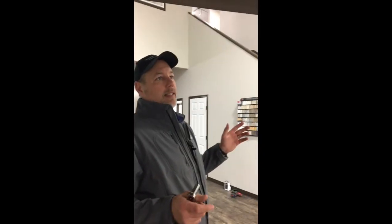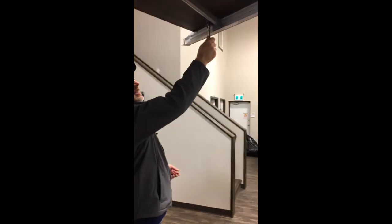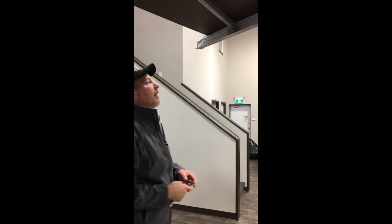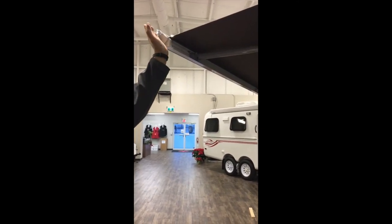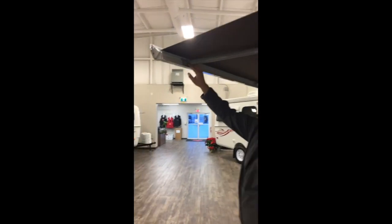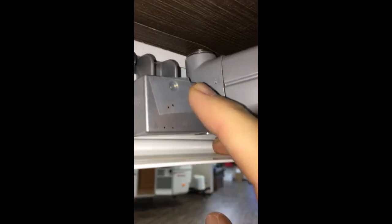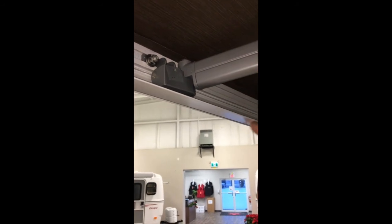We were at 10-3/8ths, so if I wanted to pull a little closer, I'll go closer to 10-1/4 so that it pulls it in. Once you've got it where you're happy and it's closing up nice — sometimes when you close it, it won't close right up tight; it'll be sticking out just 1/8 of an inch. But as long as when you push on that end there is no movement and it's firm, that's it. When you tighten these up, don't go crazy overtightening them — just snug with the wrench. Sometimes the pitch will be off, whether this way or that way. You can get it a bit tighter by adjusting that — use an Allen key in there, I believe it's a 3mm. Just a small adjustment and you'll immediately see a reaction from the lead rail to fine-tune it so it fits nice and snug.